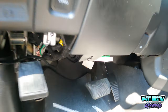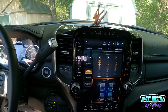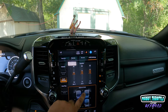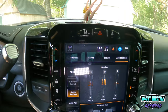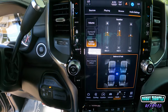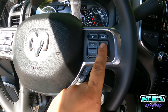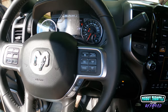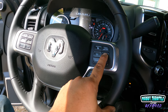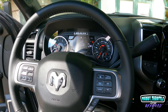All right, so we have a solid green light on the Pro Cal Snap. The only thing we're going to do today is adjust tire size. Go to Media, go to Audio Settings. We measured these tires to be 35.1, so go to Bass, Mid, Treble — set it to 3, 5, 1. We're in run position, Pro Cal Snap is green, set to Bass Mid Treble 351. Hold the brake and press the Resume Plus button for three seconds — it should honk twice. And our dash lit up like a Christmas tree, so that's not good. I'm in danger.